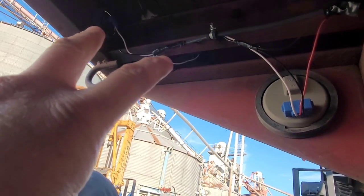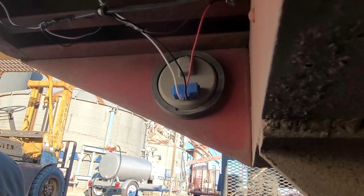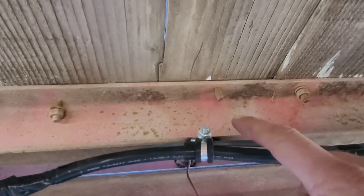Two marker clearance lights right there, and both of these lights are wired exactly the same. Stop, turn, and tail, and coming across, there's the six-way cord. It comes in, splits up there to go to the left, and then to the right. Comes across here. I've got all my studs in place to hold everything nice and tight. Instead of running three cord that was the wrong color, I just ran two cord here, the 2x14, and that's got my clearance and my ground in it. And to get my left-hand blinker, I just ran a yellow wire, as you can see what I did there.